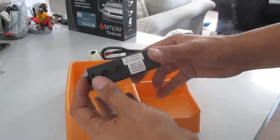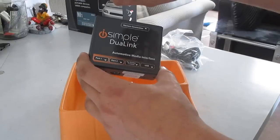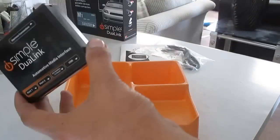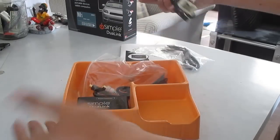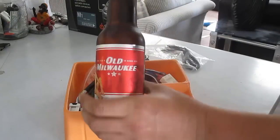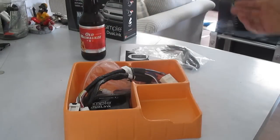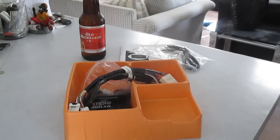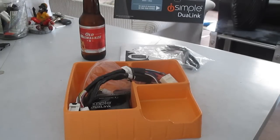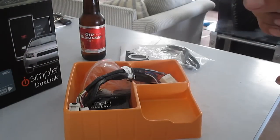And this is where all the magic happens - the iSimple dual link. Basically, this is gonna sit somewhere inside the dash, you'll have your cables coming out into your stereo, and then this comes out to wherever you want to plug your phone in. I'm going to install this myself. I looked it up and it's pretty easy to take the Altima dash out. I'm gonna crack my first beer - we'll see how many beers this job takes. Auxiliary install: 2005-2006 Altima SE, S, SL, 2.5, 3.5 - it's gonna work the same as long as you have a satellite button. You must have that satellite input.